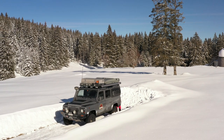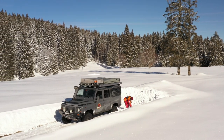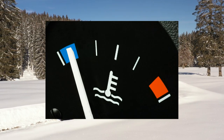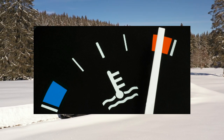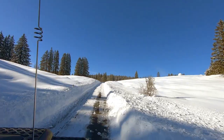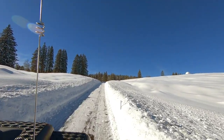The data provided by the sensors can be extremely useful when you're trying to locate a failure. For example, on Land Rover Defenders, a point we've already talked about in one of our videos is the overheating issue and the lack of graduation in the gauge temperature rise on the dashboard before putting the engine into fault or limp mode. If you can detect the critical faulty temperature with a diagnostic device, you can monitor your coolant's temperature and ease off before the overheating. Of course, this is only an emergency troubleshooting. A motor shouldn't fail unnecessarily, and it's really important to solve the problem as soon as possible.